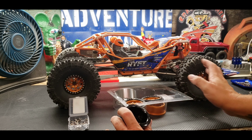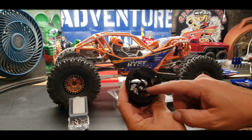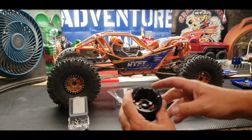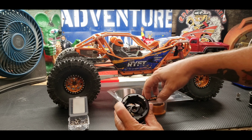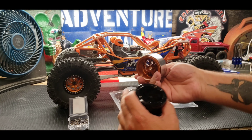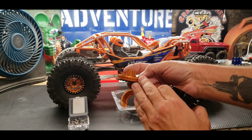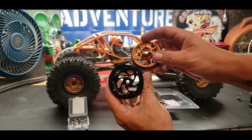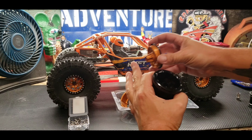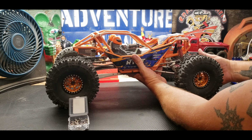In case you want to put wheels on your Rift, this is the style you want to avoid. And it's not because they're not the right size. It's because the way this sets down in there does not give you enough clearance room. See how this one's got, oh, I can pull a face ring out and show you better. How this one's got the socket that protrudes out. This one does not. So you can get a pretty good idea how much more your wheel's going to stick out with this style, which is what you're going to need on the Rift in order to clear your hubs.